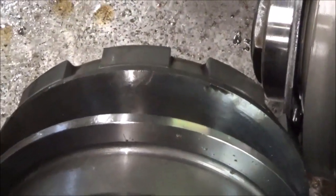Get a little closer. You can see these little scratch marks in here. If they're up top on the driven pulley, they're going to be in the bottom of the drive pulley — those scratch marks right there. Now look at the drive pulley — you will see the scratch marks right there. You see all those scratch marks? No good.